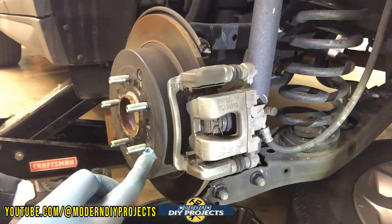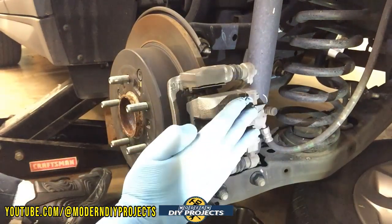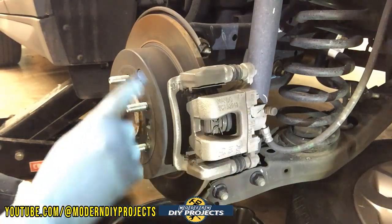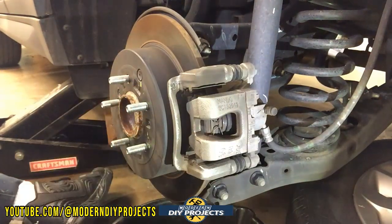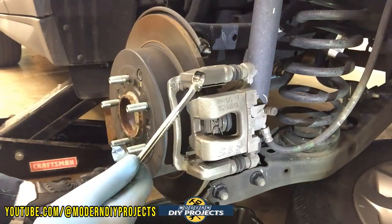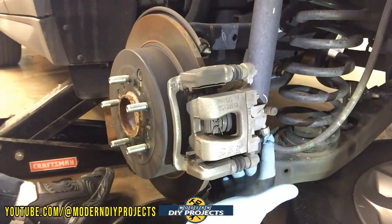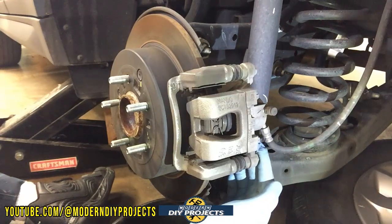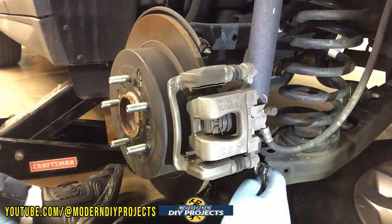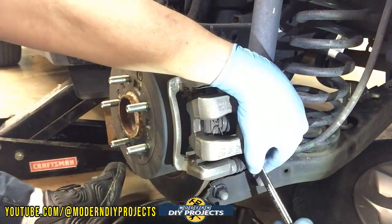This vehicle does not have the electronic or automatic parking brake — it has the manual parking brake. Therefore it does not affect your brake work. The pads are not part of the parking brake on this vehicle — that system has shoes inside the drum and we're not worrying about that today. The rear is pretty much just like the front, but with a couple of tricks. You'll need a 14mm wrench instead of a socket for the bottom bolt, because Hyundai placed the brake line too close — even a stubby socket won't fit.